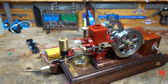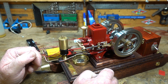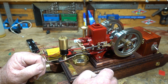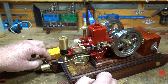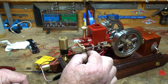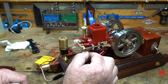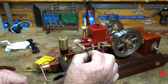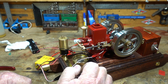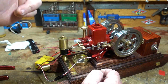Once again I really appreciate all the advice. I've got plain petrol in here with some two-stroke outboard two-stroke oil. That's definitely wet. I'm just not sure — close that off again. So that's half a turn. You guys that know more than me, if you could tell me: do I need more than half a turn on that? So we've got fuel there, we've got a very good spark there.